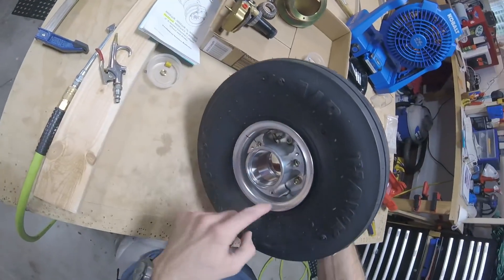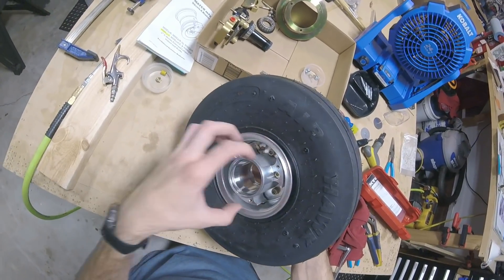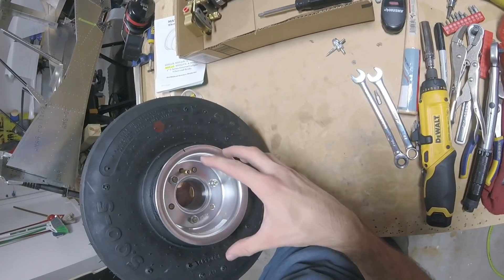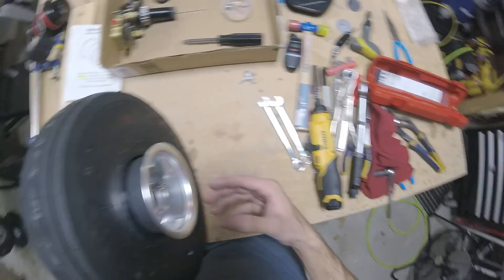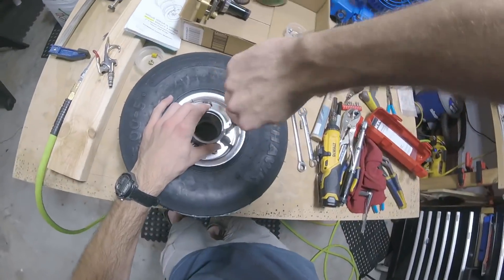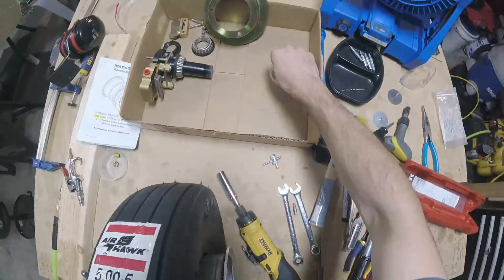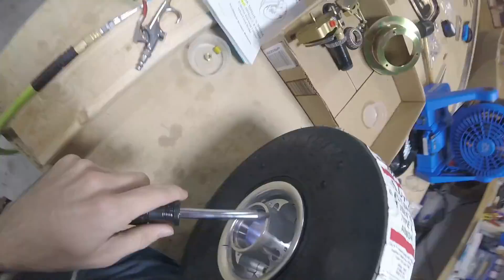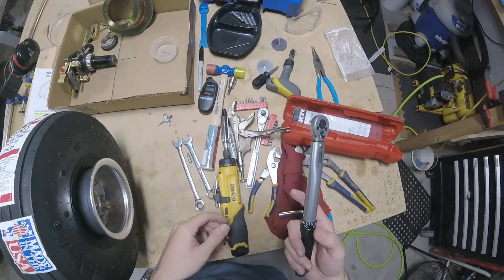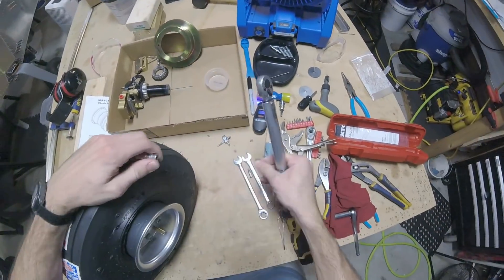You can see there's still a gap between the hub and the wheel, but when we tighten the bolts down it's going to bring the hub back into the other half of the wheel — basically pulling them back together. We don't need to press the hub back in separately. Run these bolts all the way down — that should be pretty snug. I have my torque wrench set to about 100 inch-pounds, which is what the manual says, but check your manual and set it to the proper torque for your application.